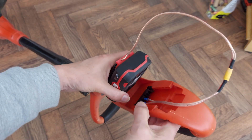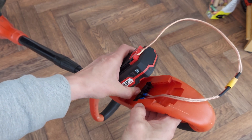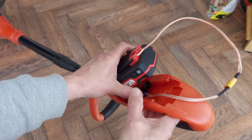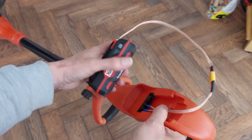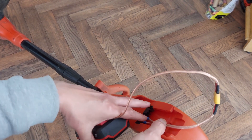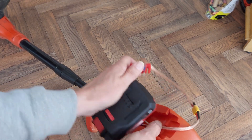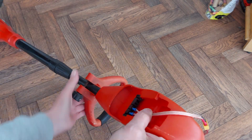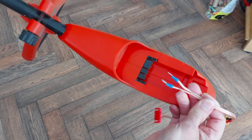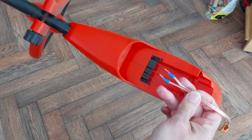The problem with not having that strapped in at all is I could accidentally pull that out and have two bare live tags that could short together and upset the battery. So at the very least we ought to do a little connector piece that holds that in place. If I just pull that off there so we're safe — yeah, you could just pull that out and then you've got those two blowing around in the breeze and accidentally short them together and you've upset your battery.